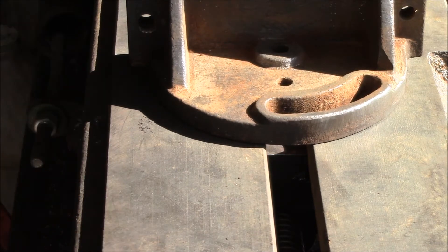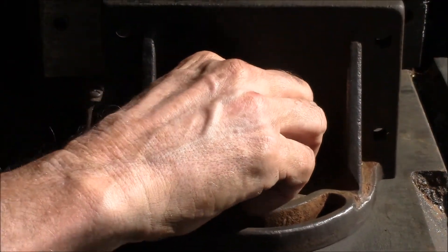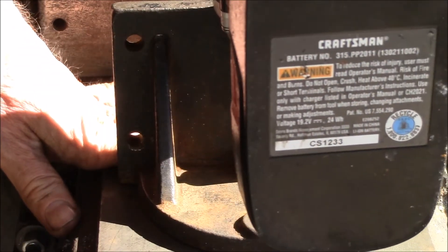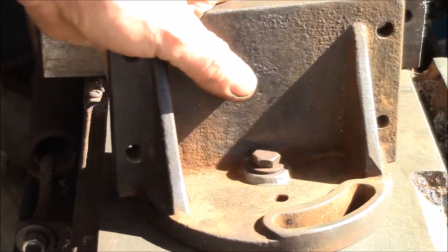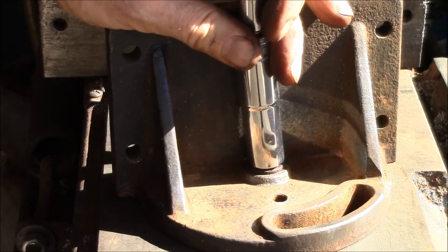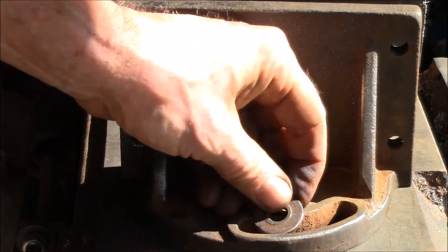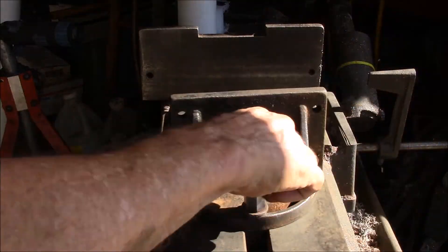The trick to assembling it is to just drop this on the top, then put in the fixed pivot bolt. You've got to get that bolt started in the hole. These are three-eighths coarse — three-eighths 16 threads per inch — use a 9/16 or 14-millimeter socket. This one needs to be tight but not too snug: it needs to be able to pivot but not too loose. Then you've got your clamp-down screw and it's back together.